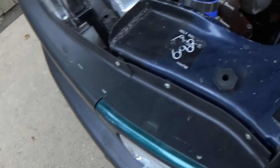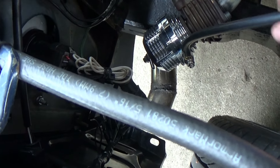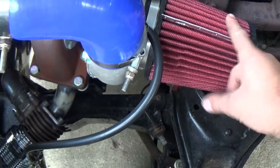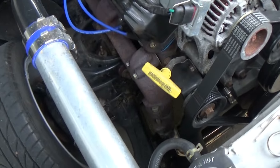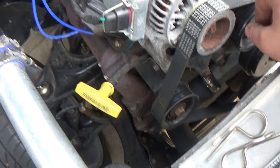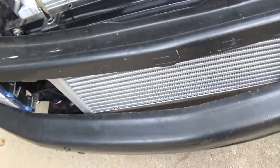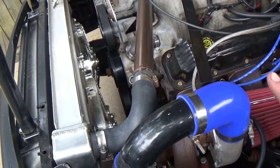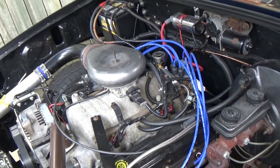As I mentioned in the last video, I pulled the top off the wastegate and cut the spring down, so now instead of making 15 pounds of boost and over-boosting we're making about seven, which is perfect. Got an air filter on there, so we're all protected. The belt is still squeaking like crazy even after all the driving, which is obnoxious, but I guess that is what it is.